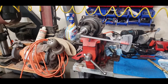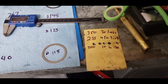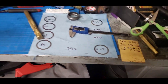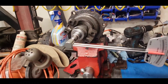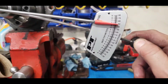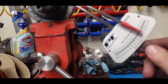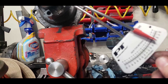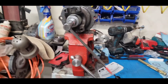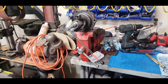Man, this thing is finicky. I was at 300 thousandths and it was 10 inch-pounds. So I took a guess and went to 275-280-ish, and now I'm too tight — the thing's at about 55 inch-pounds before it starts moving. So now I'm 15 inch-pounds out of spec. Good times. Now I've got to take it back apart again.